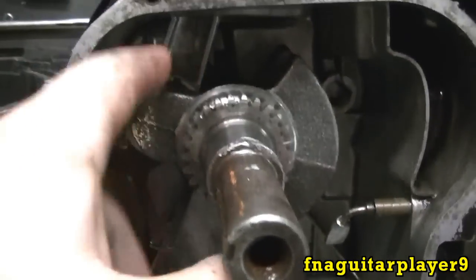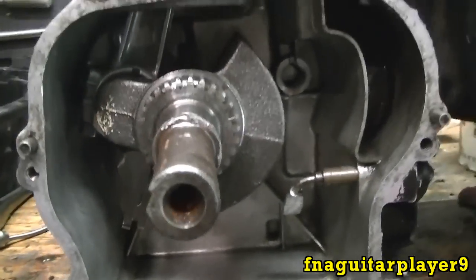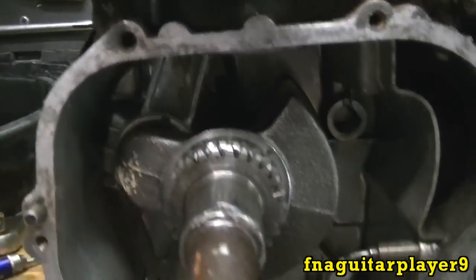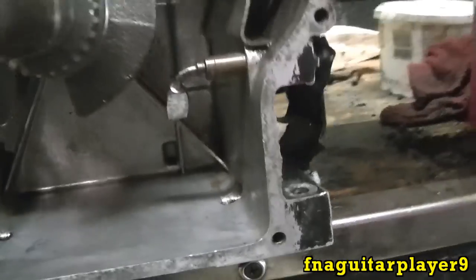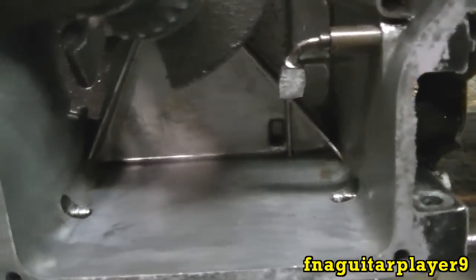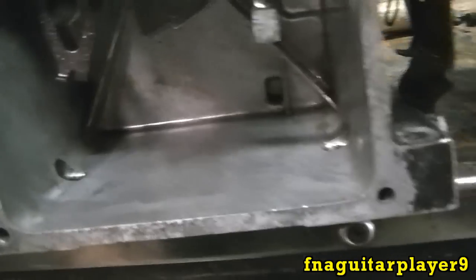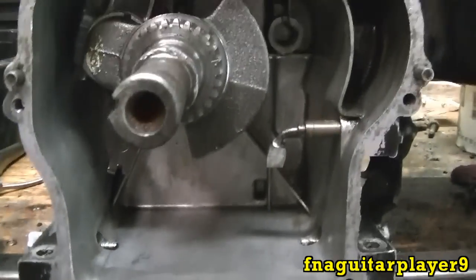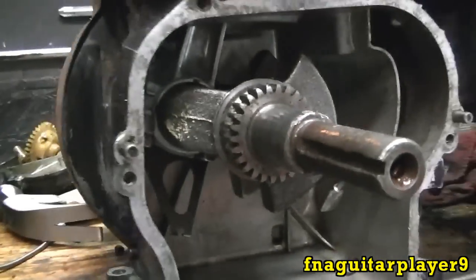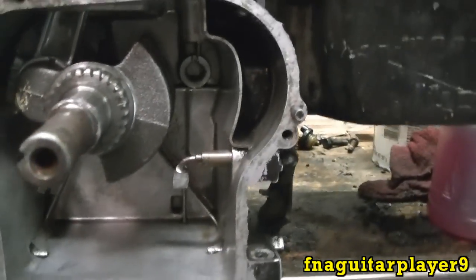I generally like to keep carburetor cleaner away from the connecting rod, because it'll go in there and clean out all the oil pretty much. You don't want that. Also, before I put it back together, I'm going to squirt a little bit of oil down in there so it'll be oiled a little bit better. Another thing, I just use a basic degreaser. I'll write in the description more about the brands of products I use if you're interested in that. That seems to work pretty good, and you can see I got it cleaned off pretty good. Eventually I'm going to be painting this motor up.